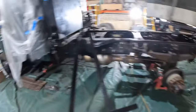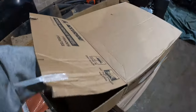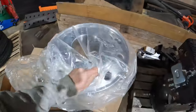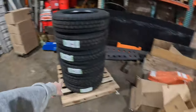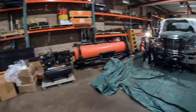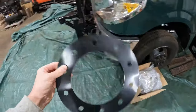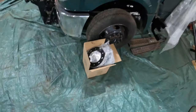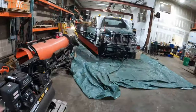We also have — over here — all new aluminum rims for this truck. So this is going to be pretty nice. We have the same rims here and those over there are for the red 4300, but these four are for this truck. On both trucks, the back inside stays steel and the outside gets the aluminum — there's no reason to put aluminum on the inside, you're never going to see it. But you do get these little plastic rings so that where your aluminum and steel meet they're not sitting there rubbing on each other and don't get seized up together — it just keeps a little bit of material between the two metals.